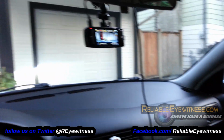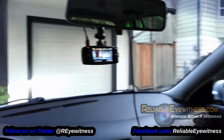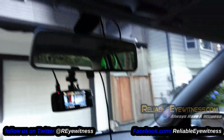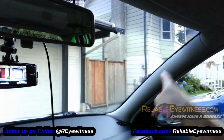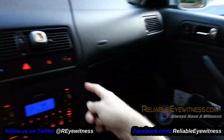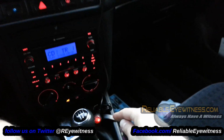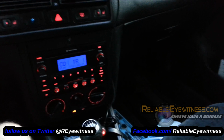And of course you can route your wire any way you want. We just have it up here for testing, so we'll just leave it that way, but it's very easy to run it along the top of the headliner, down your A-pillar, around the dashboard, and you can plug it into the same port, or you can actually hardwire it in permanently to your car's wiring.